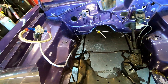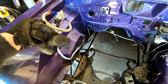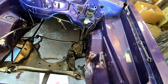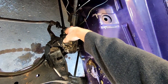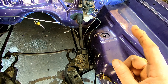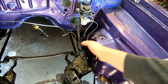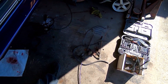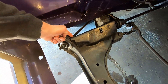Here's where we are. I'm going to tape the fuel line out of the way or wrap it in aluminum foil — I think Colleen Tebow recommended that before when I was painting under the hood of the red car. I broke my distribution block loose so I can wire-tie that to the column. I thought about taking the column out but then I'd have nothing to wire-tie to. I popped the master loose so I can get my gun around a little easier and shoot up through here. There's the stuff out from under the dash — a little weight reduction. I'll get my grinder now with a nice wheel on it and take off these brackets.